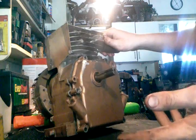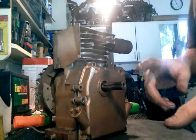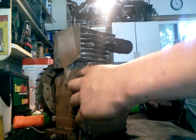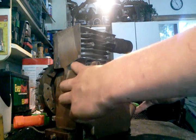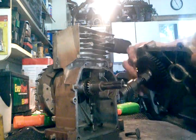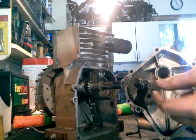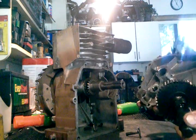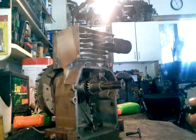In this model there are six bolts that hold the crankcase together. You want to be careful when you take the crankcase apart because the camshaft may fall out and your push rods may come out — on this one they did. So this is your inner crankcase and your camshaft, put this one to the side.